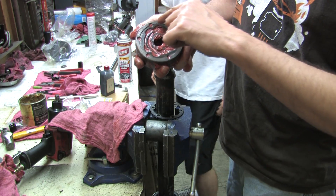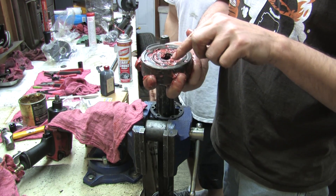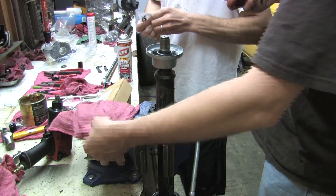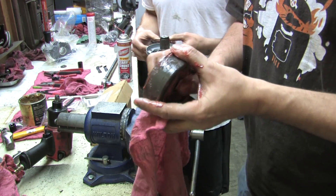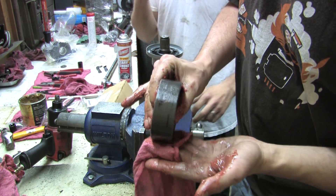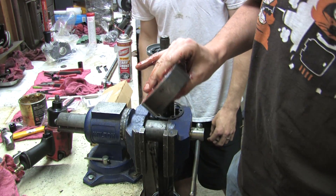There's one side of this little ring that has a recessed ring, and the other side is completely flat. You want to put the side with the recessed ring facing the boot. But before we do that, we need to put a gasket down here. Somewhere under all this grease there's also a marking, and this marking indicates which way we're supposed to put it on the shaft. The arrow means it goes towards the front of the car, or the yoke — because that's the way we marked it.